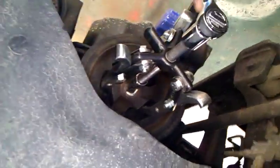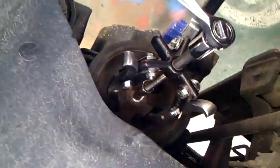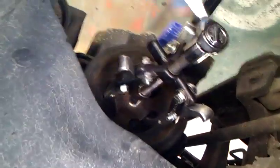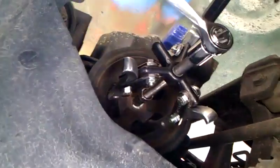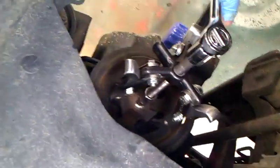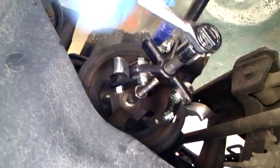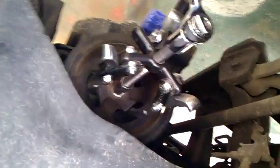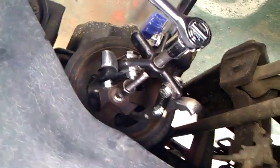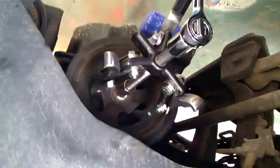It's almost out — at the end it becomes easier. Make sure your pulley tool is balanced; you don't want to put pressure on one side. As you can see the socket is getting closer, that means the pulley is coming out. If your pulley takes too much pressure, that means something is wrong — the extension that you put in there might be too thick.